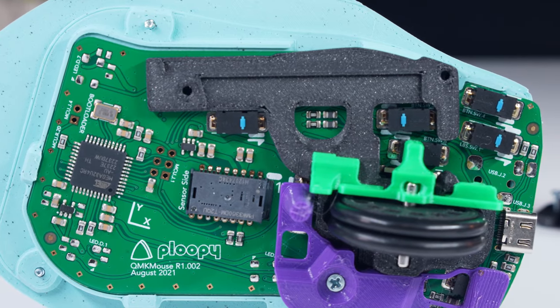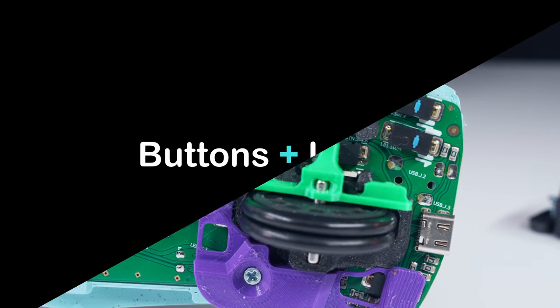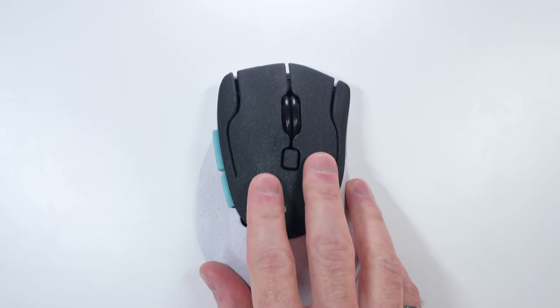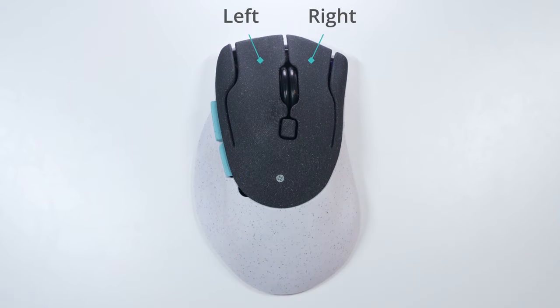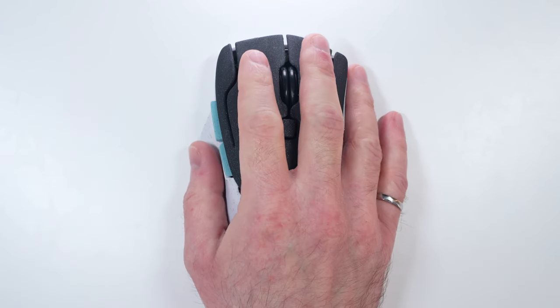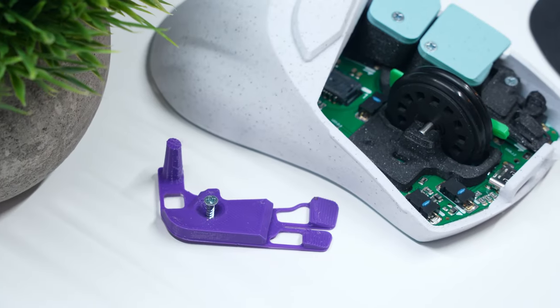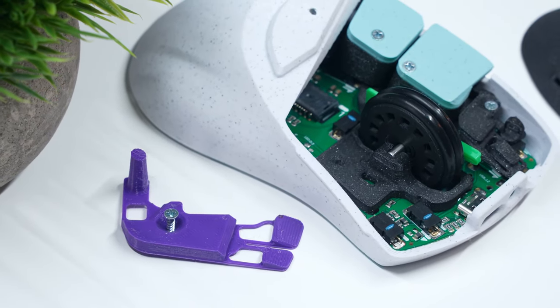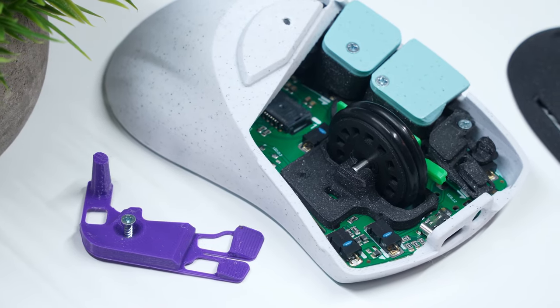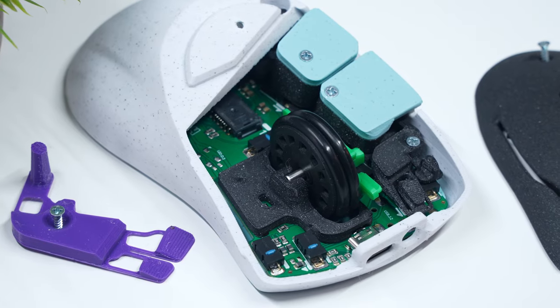From my experience, you buy the Ploopy Mouse for three reasons: the buttons, customizability, and the ergonomics. The mouse has eight buttons — the standard left and right click, the central scroll click wheel, two more peripheral left and right buttons, a central button above the scroll wheel, and front and back thumb side buttons. All are easily triggered, with only the central button above the scroll wheel requiring more of an intentional reach. They're all driven by 3D printed components with living plastic hinges, and sit atop Omron D2LS21 switches, which have a firm and reliable 61 gram force operation point.